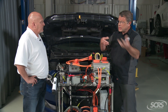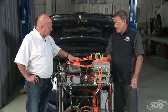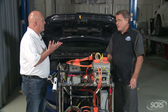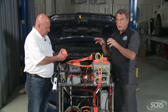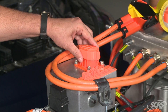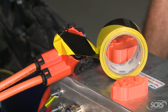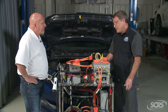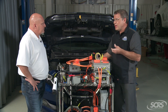What is the recommended best practice? If the vehicle maker has dummy plugs designed for this purpose, those should be your first default. In some cases vehicle makers may state you can use those, or you should mask and tape it very well. I like to use a non-conductive, highly visible tape and cover it up really well. Depending on your situation, a baggie zip-tied over it also works — ensuring nothing can get in to contaminate the connector.